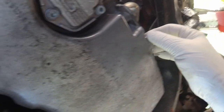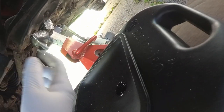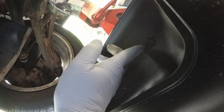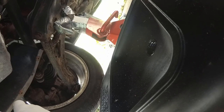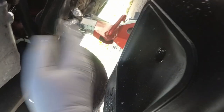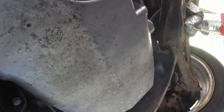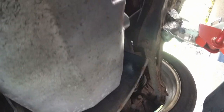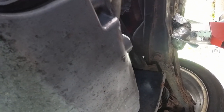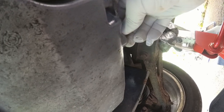Okay, we're ready to go with the oil. I've loosened the nut off and I've got the oil catch can in place. Remember - and I got caught out once - there's a plug to take out here and also one on the top to let the air out, otherwise the oil goes everywhere because the air has got nowhere to go and it starts spitting out. The oil isn't going to drop straight down, it's going to come out in an arc, so I'm going to open it gingerly to make it dribble into the catch can.